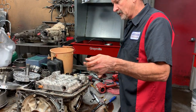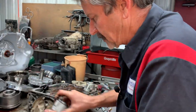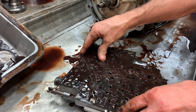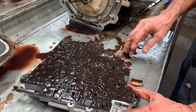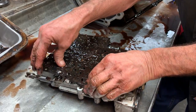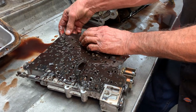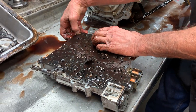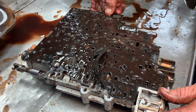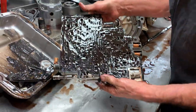It's missing a bolt - just stuck really good. Now remember these guys go to the river, and anytime I see a gasket that's physically stuck on here like this is, it's had water. Because these gaskets here do not do that - period. They come off pretty much every time no matter how many miles are on them. So this would be a train wreck to clean up - a lot of scraping.